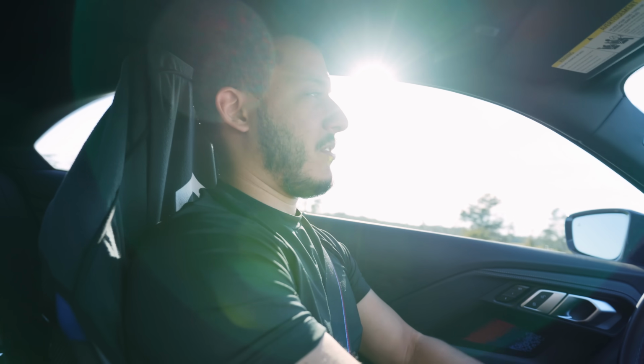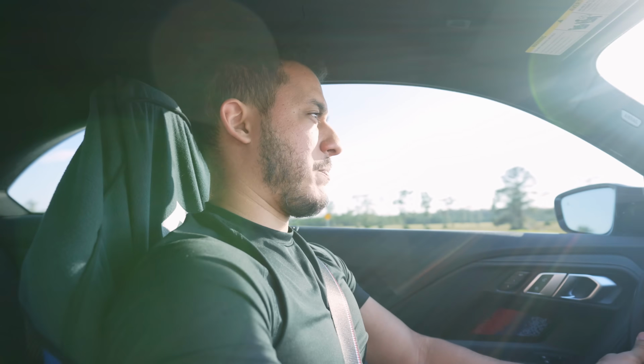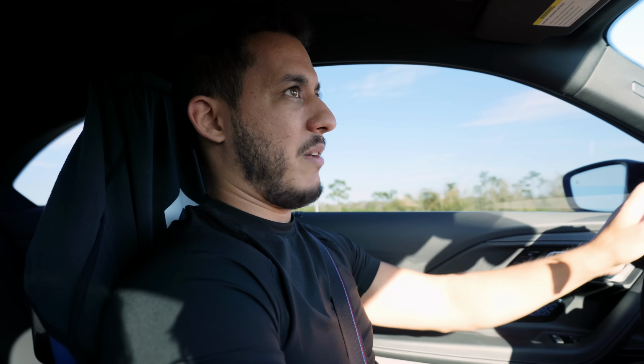So I would say the clutch pedal bushing kit doesn't really change that. It seems the same. Nothing's really changed. It doesn't become easier, harder, or anything. But what does change is when you're going from second to third to fourth, I feel a lot more confident getting into the next gear without worrying that I'm going to miss the gear and then rev the car, which is always scary, right? If you're flooring it, you miss the gear, you can rev way too high, you can damage your motor. So I'm a lot more confident I can move into the next gear without missing it, shifting quickly.